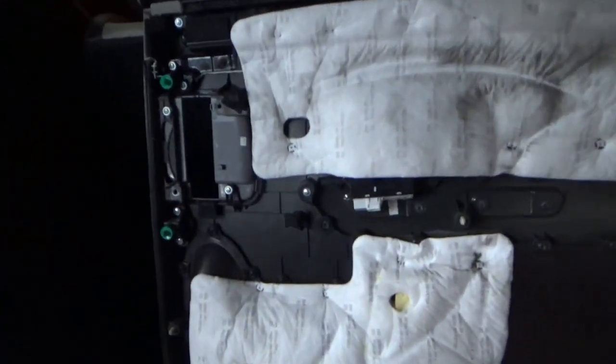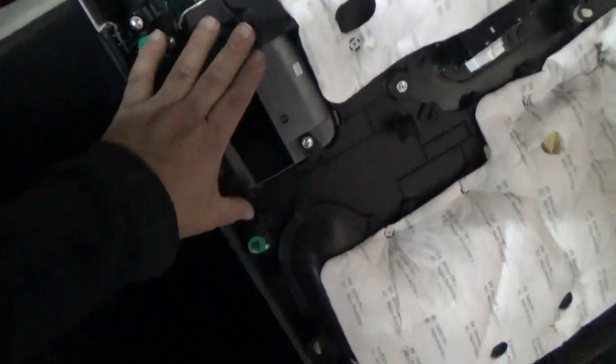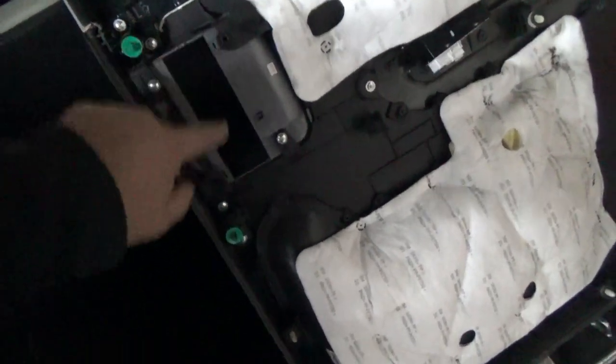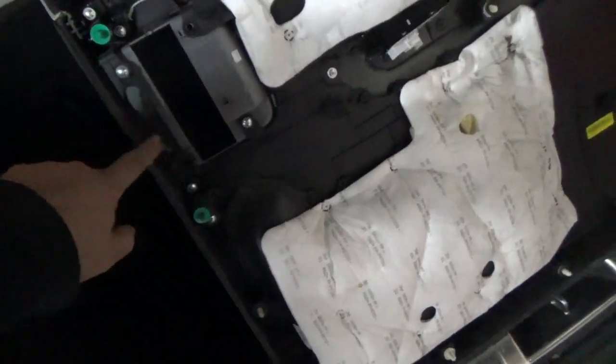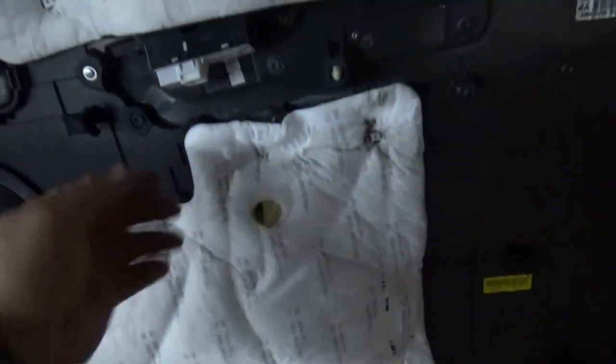Alright, while we got it out here, I'm going to show you a little better. We got two door screws right here. One on the handle, two. Take them out. You pop the trim cover off. Screw right here when you pop that trim cover off on the post of the door. Take that screw out. Then you got all these clips — there's even a few in the middle. So that's what makes it tough. Pull it back, unplug your wire. Boom, it's out.